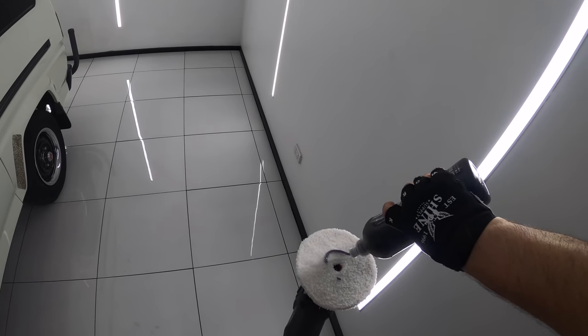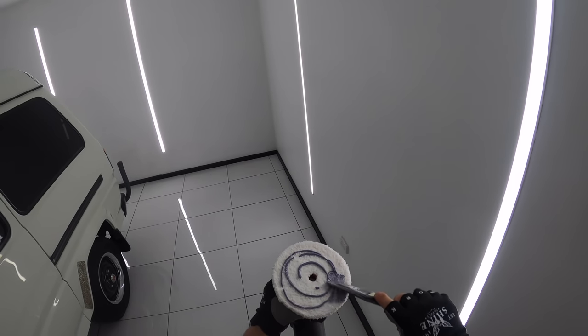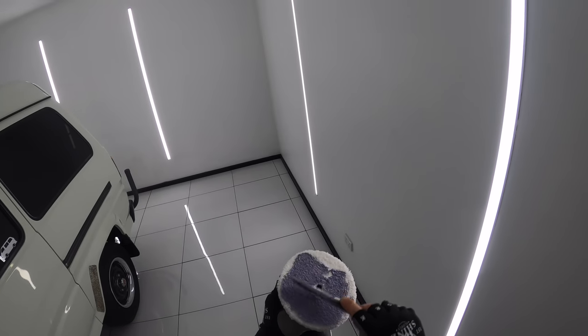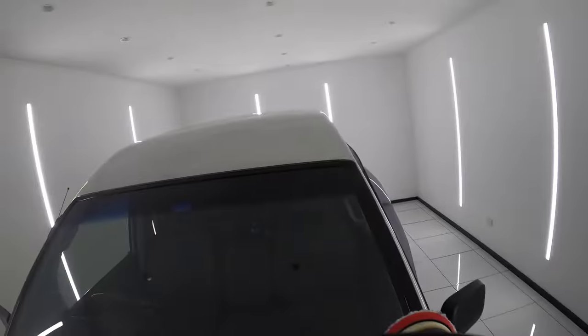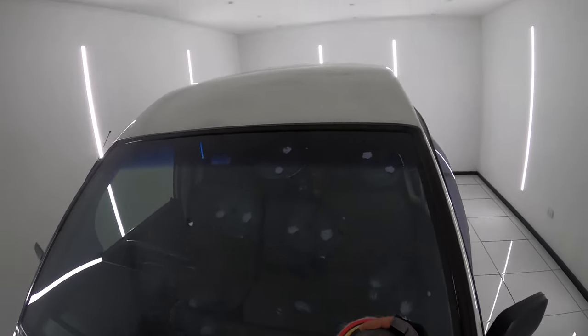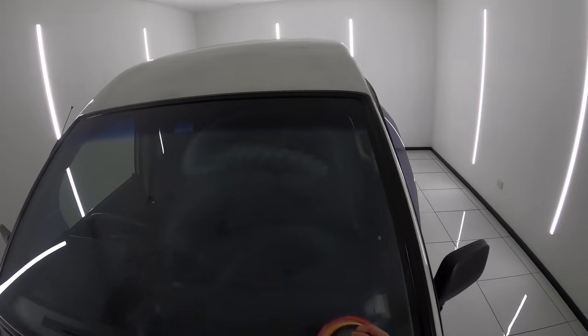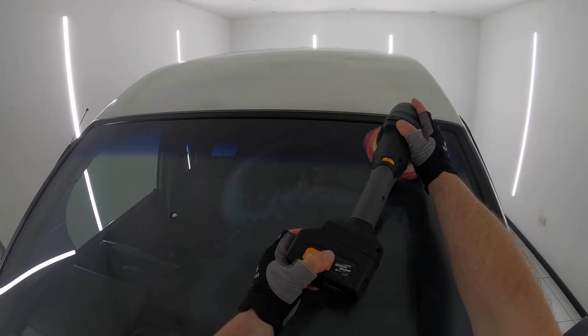As far as technique goes, I'm going to firstly prime my microfiber pad, but after that I'll just add a few drops of compound for each new section. I'm going to work larger areas, such as half the windscreen at a time, spread the compound in, set my polisher to top speed and use moderate to heavy pressure, and a moderate arm speed, doing about 3 passes in total.